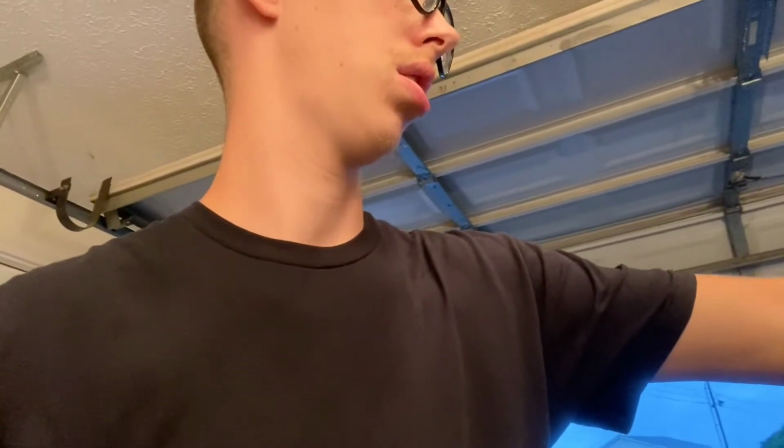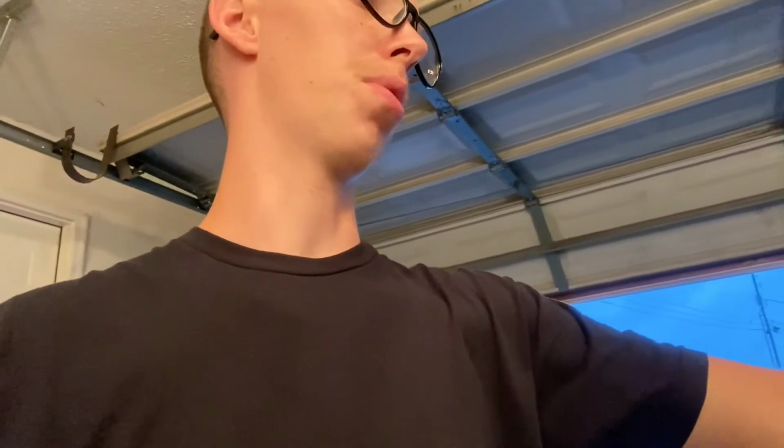So I looked down in there with a light, and the threads are pretty rough. And in the 2 years that I've had this intake, I've never had a single bolt in there. I did get it off of a friend of mine. I'm not knocking him or throwing any shade towards him, but he said he doesn't remember having any issues. But like I said, I clearly haven't had anything bolted up to it because it's just now getting put on the car. So my same buddy loaned me his tap and die set. If anybody knows how skeptical it is tapping really, really soft material like that, then you know what I'm about to go through.